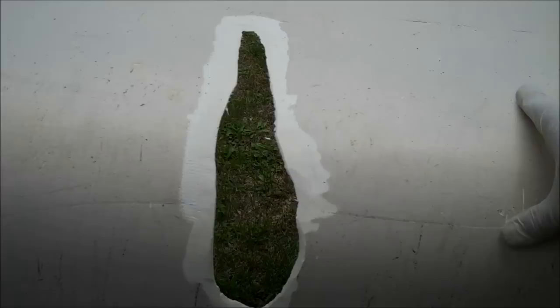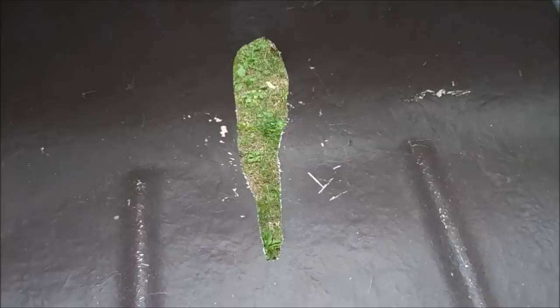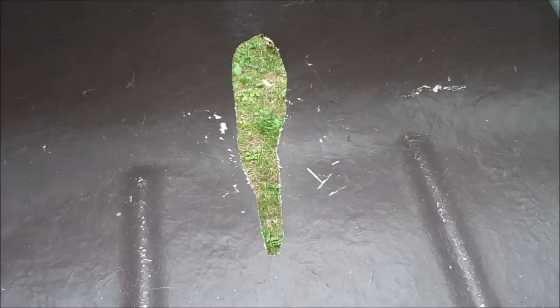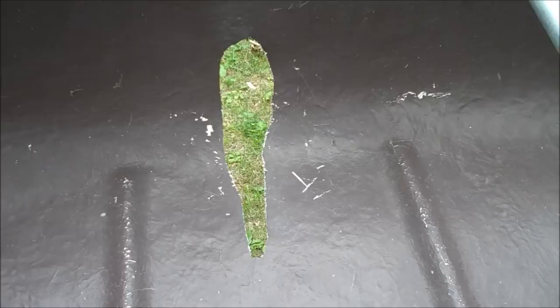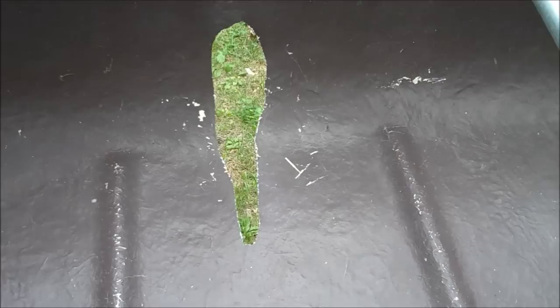I've flipped the canoe over, which is nice because I can get to the other side of the hull pretty easily. I'm going to rough up the area on the inside as well, because this is actually where I'll start the repair. On boats you can't always do that because boats are usually double-hulled and you can't get to the other side. On a canoe like this, that's what makes it so easy — you can get to both sides. I'm going to make a nice smooth cloth repair on the inside and that's going to be my base for laying the repair from the outside.